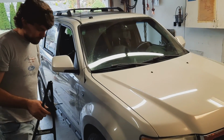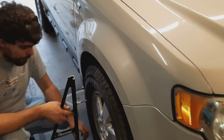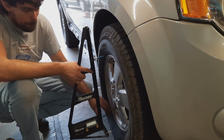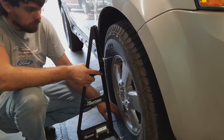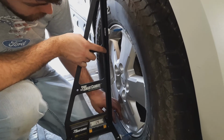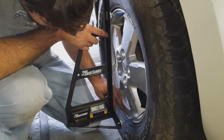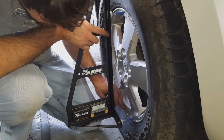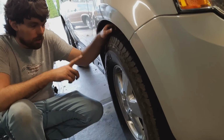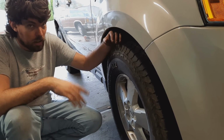All right, so we took it for a lap around the block. Well, we made some more adjustments on the knuckle to get it in where I think it was right without driving it. So we took it for a drive, and we're looking for about 0.6. What is it, 0.6 positive we're looking for? Negative. Negative? Yep. And there we have one negative. We are within spec now. Yeah. Both for the one wheel and for the side-to-side matching.